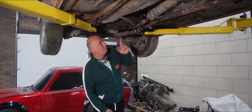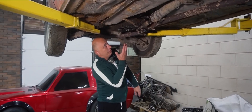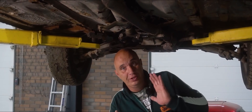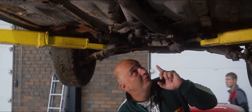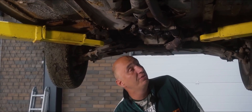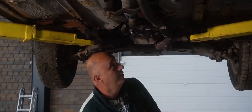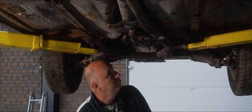All right fellas, we couldn't help ourselves and we decided to get the car up on a lift. I'm examining the box — I'm really curious as to what happened in there. So when you release the clutch in neutral, the car attempts to move. At a quick glance, I don't see anything horribly wrong in there, but you can tell that the gears have a sort of bluish hue — that's a clear indicator of overheating. The gearbox was lacking transmission fluid, so... let's remove the box and figure it out. There's only so much you can see from down here — let's drop it, take it apart, and have a look.